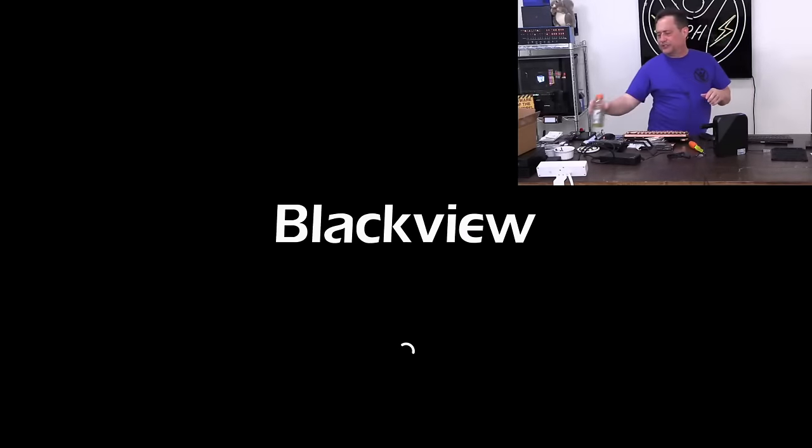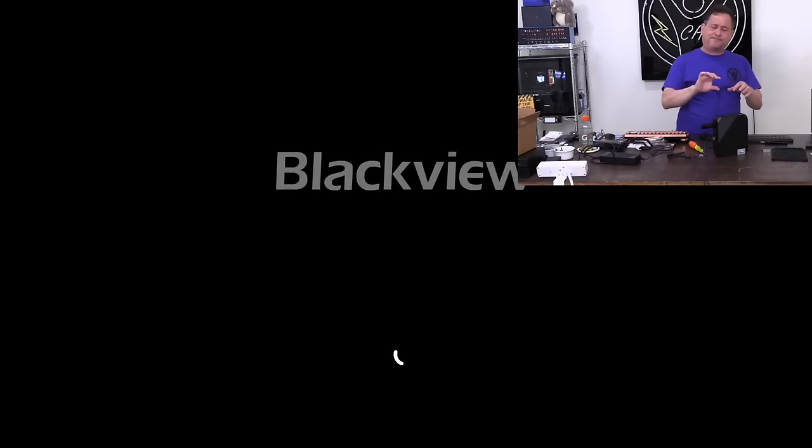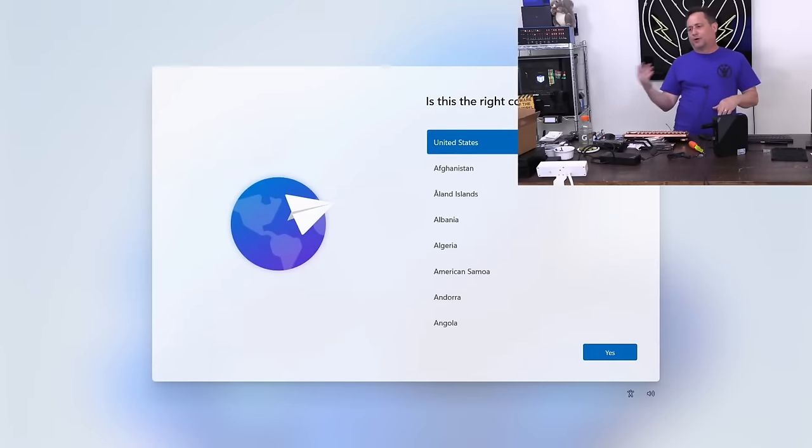As you can imagine, sort of these stumbling blocks that I run into, like the rescue disc doesn't load, or you find out that the heatsink gets in the way. This is what happens when I'm refurbishing the older units and why it takes so long to set them up. Something that you think, oh, you're just going to put Windows on it, it should take 30 minutes. No, it usually takes, on average, with all the unexpected things that occur, I can't find a driver, there's a new BIOS, but now the BIOS doesn't apply correctly. Or, you know, the controller's in RAID mode, I want to put it to AHCI. So that's a real tricky thing.